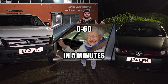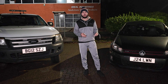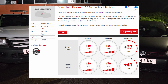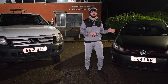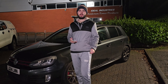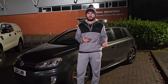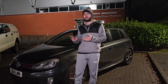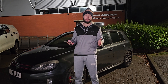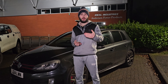Let's say you decide to go down the performance route. First thing you can do is remap the engine. Easiest way to check — go on a website such as Celtic Tuning, put in your engine and they'll show you if you can benefit from a remap. Anything less than a 10% gain is pretty much money thrown out the window. A remap is roughly around £200 and a dyno run is about £60 for three runs. That's the money you're looking at to get your car flashed and actually see if it's made any difference in power. I think you're realising at this point that cars are expensive to own and modify.